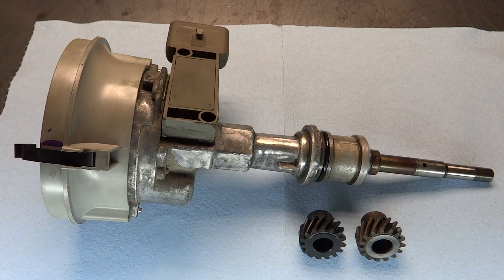What happens when you mix them? If you run a cast iron gear on a steel camshaft — this is something I have an interest in, and if anybody knows more about this I'd like to hear it — there is an incompatibility between running cast iron parts against steel parts. They don't seem to like to wear together. I don't know if it's the iron or the steel that gets worn away first, or if it's a mutual wear where they both wear each other out rather quickly. Now, I did run this gear on that steel camshaft for a little while, and I did not see any signs of damage. But it honestly did not run like that for very long. And there's something else about that distributor gear I want to talk about later.